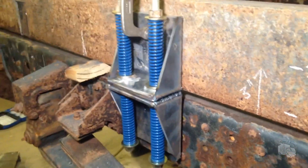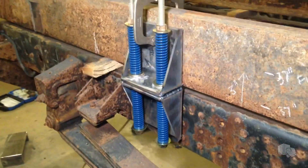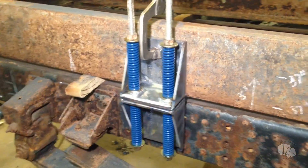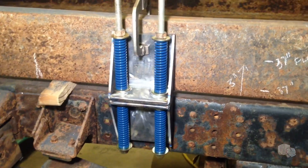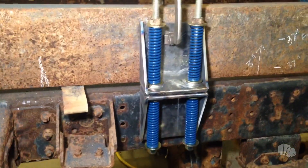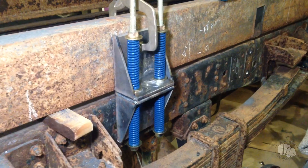Splitting the springs to upper and lower allows for a more compact mount. These springs will allow for about 7-8 inches of travel when minimally compressed. This mount is specifically for the front end of the chassis and will be more compressed for a tighter spring tension. The mid and rear mounts will use slightly different spring rates and lengths, but using the same basic concept.